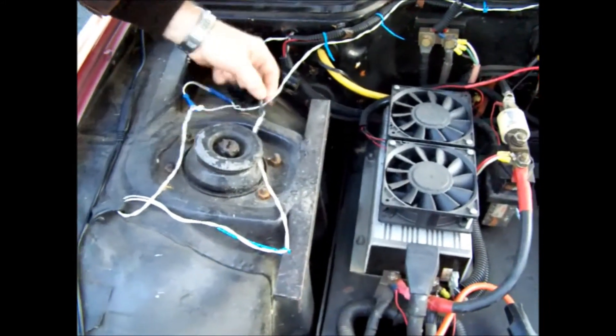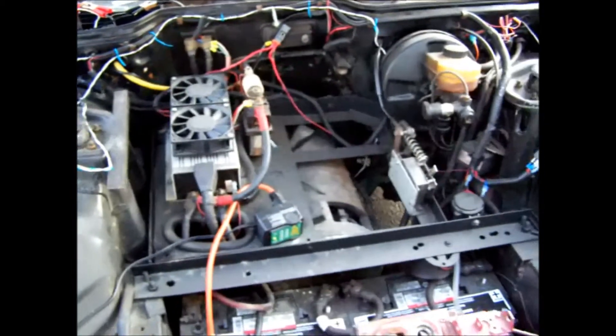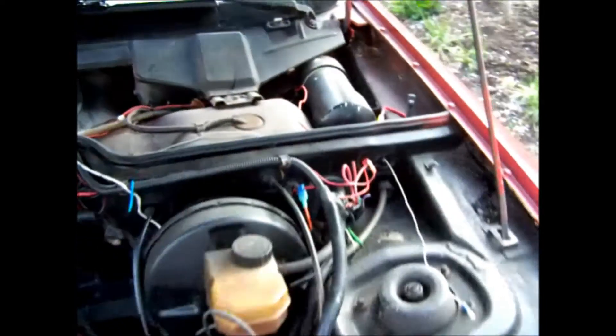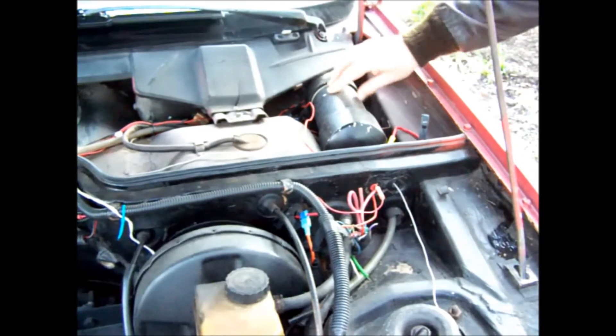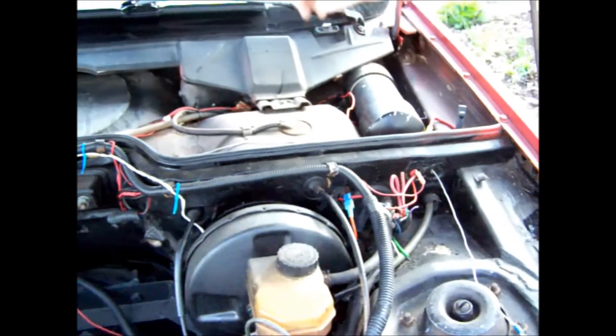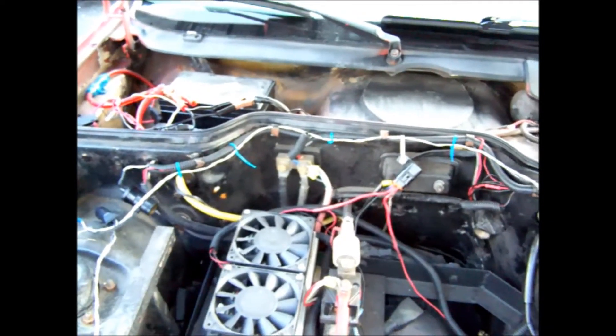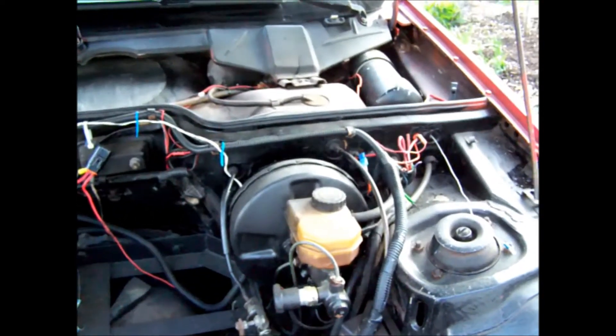Because that wasn't all that successful when the cover was covering the solar panel. On that side, on the inside here, there are two DC-to-DC converters in parallel for redundancy, to provide the 12 volts to the vacuum pump. So that way you're guaranteed you've got your power brakes. With the weight of the batteries, you want to have some extra boost.